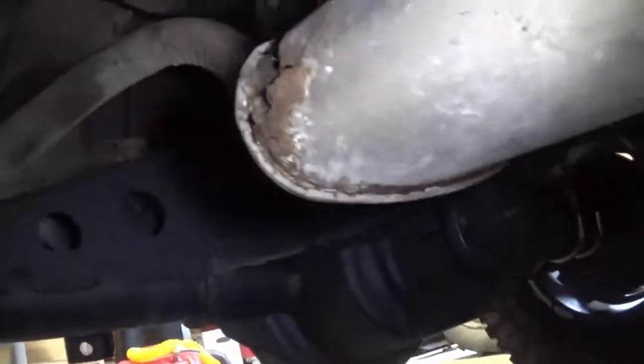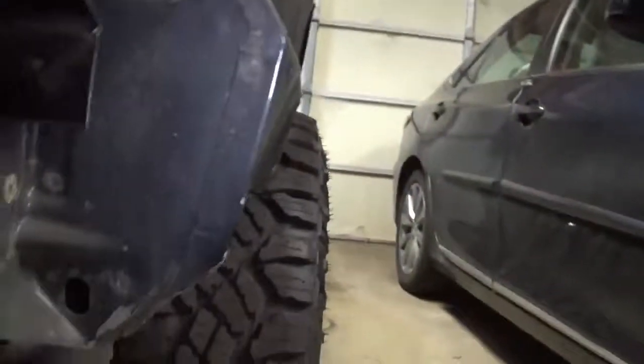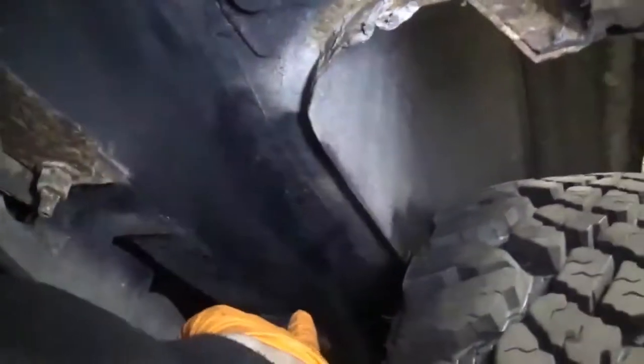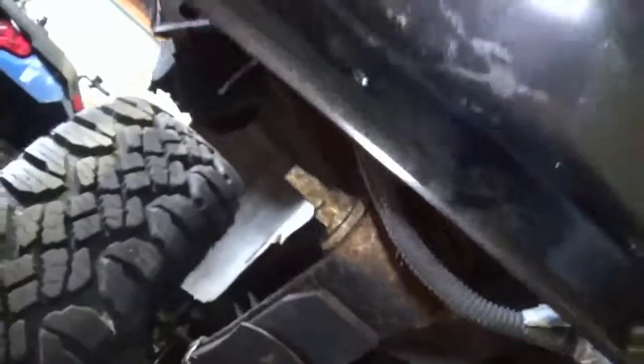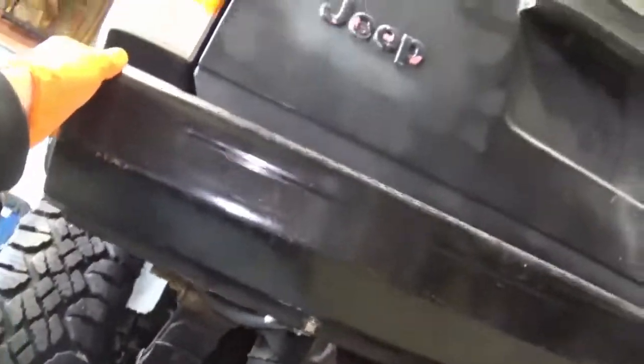Now that I have it in there pretty much correct — as good as it's going to get — the tires for the body are pretty much the same. Now they both stick out the same amount. I did that quick measurement again between the frame rail here, or the unibody, to the tire, and they're both about six and a half inches away from the tire. The driver's side is a bit more, but it's like an eighth of an inch more — very, very small, you can't really tell by your naked eye unless you're super picky about it. But it's not that far off now, and I don't have the leaf springs bowed in to get the axle in.